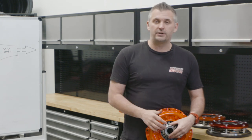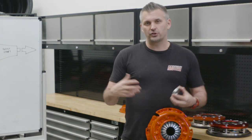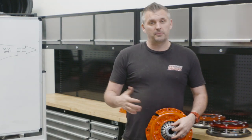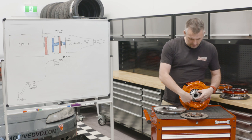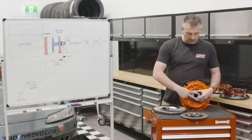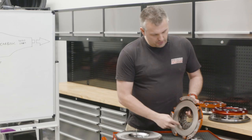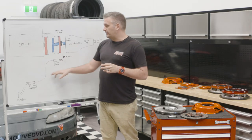A lot of clutch manufacturers will tell you to switch to a push-type clutch, especially in the GTR, simply because there's more options available for the different types of clutch combinations you can build. So you'll find that a push-type clutch is more common, but some cars do come with pull-type from factory — late-model GTRs and WRX are pull-type clutches. On a push-type clutch, the clutch fork pushes against those fingers, and the pressure plate moves away from the clutch to disengage.